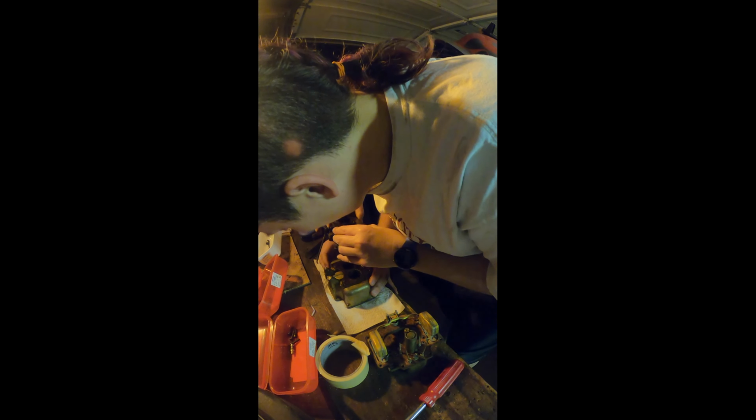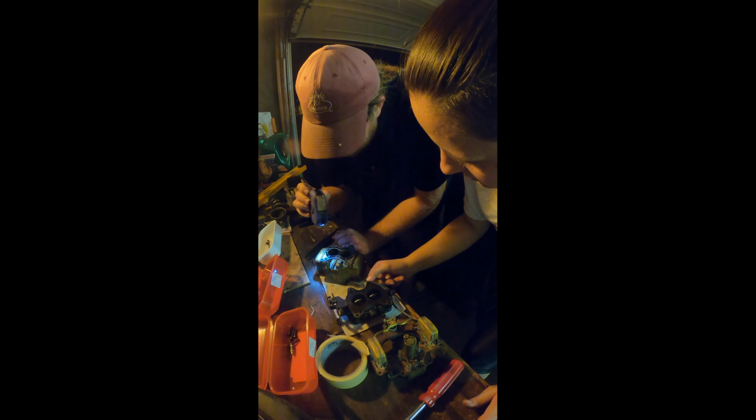Voila. These gaskets aren't holding anything back. See, so there's your channels. So your gas. Those gaskets are like, damn, that's pretty pitted. That's where all the leaking is. We're going to have to clean that up. All these little holes, we're really going to have to clean them.